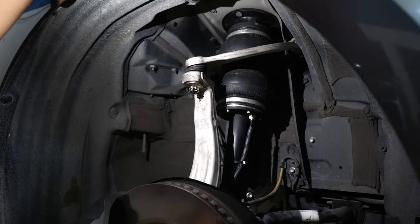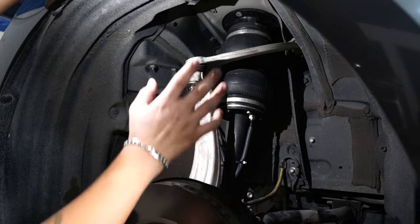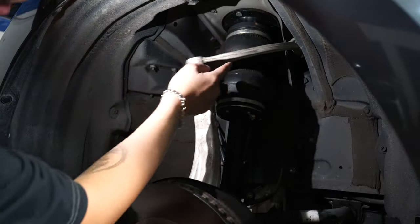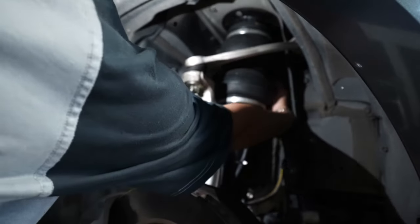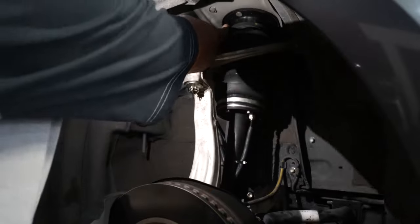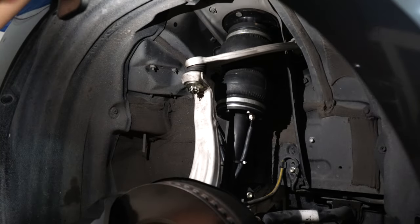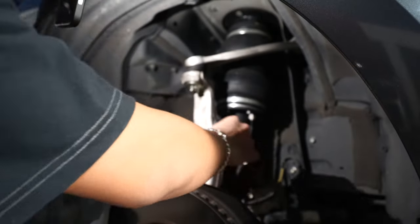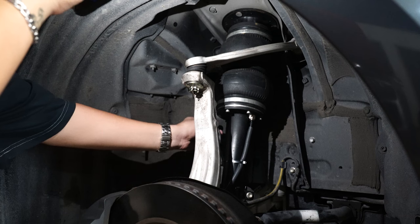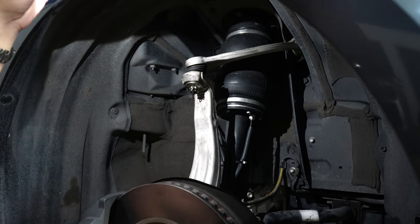Welcome to the front section of the IS350. As you can see, we are greeted with a wishbone suspension — not a McPherson-type strut that pivots around an axis on top. This is the wishbone, and we actually have a ball joint instead that rotates. For clearances, there is a lot of space in the front. It's a bit close to the control arm on the side, but nonetheless it's still pretty clear. This is a double bellow slim bag, and for our hose line, we just followed the stock brake lines here, which go into the engine bay and then through the chassis to the valve. Let's ask Irvin to turn the wheel so we can check our clearances.